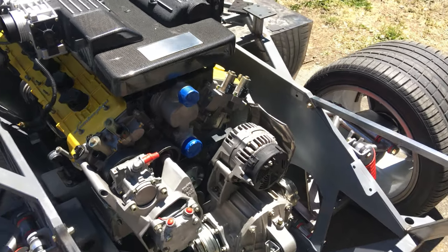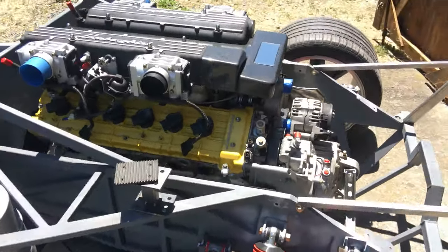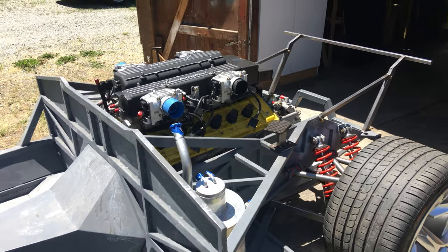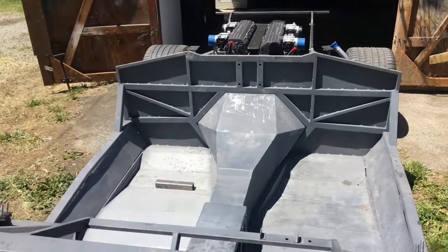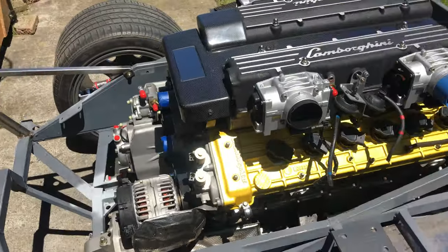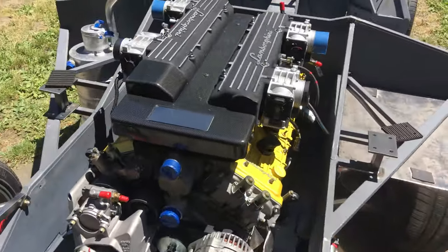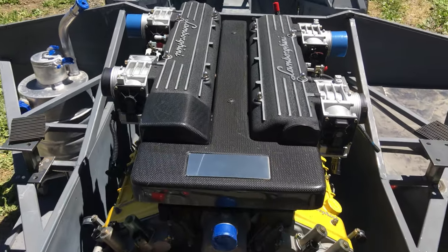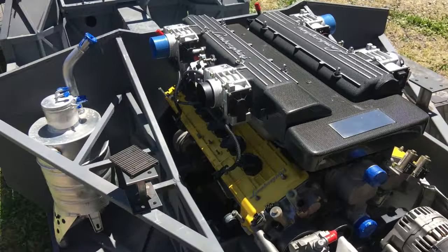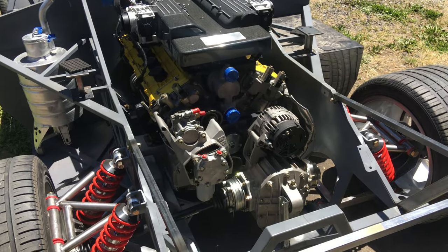Better just had to wait the five weeks for them. As far as going forward, I'll be ordering radiators and oil coolers probably this week and start working on the plumbing. On the walk-around: the engine sits flush to the bottom of the chassis, raised about an eighth of an inch, and the top of these bolts from the air intake have about a half inch to three quarters of an inch clearance to the deck lid. I already put the body on and confirmed clearance — everything's tight but it fits. Thanks for watching.